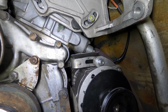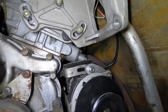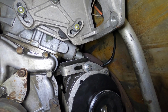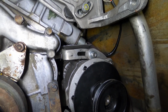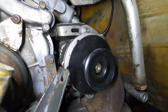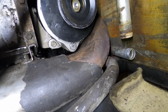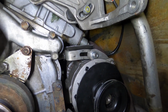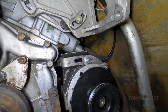when everything is installed. So I decided to obviously seal it, clean it, get it so it stops dripping. But if it starts to drip again, I've made this tiny little aluminum shield to just divert the oil around the alternator and also around the header, because as it drips, look, the header is right below it. So as it drips onto the alternator, it follows it down and then eventually onto this header, and then it'll smoke. So this diverts it around and onto the ground. I hate making little stopgap measures like that, but you know, in a Dino, it's probably not a bad idea.